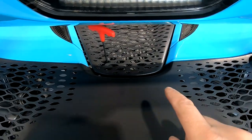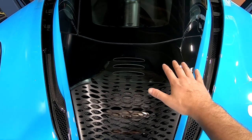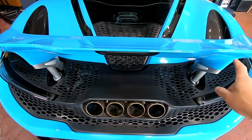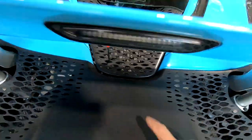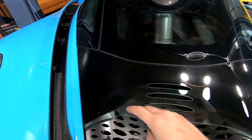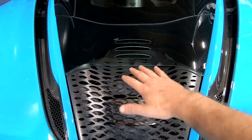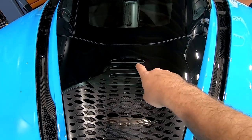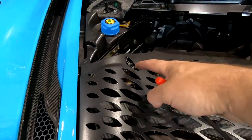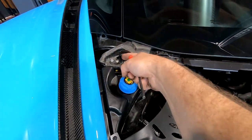One thing that is a little bit different on a 720 is you've only got a couple screws that you can clearly see, and then the whole thing sits in place. But they're a little bit different on the 765 - we've got to manually lift the air brake up, which you do not have to do on a 720. There's a screw there, screw there, screw in there, screw in there, and I believe this is just going to pop off once we get all those loose. Those screws down here are for this piece, and there's two more down there, so we're going to get those off to get this whole thing off, which will give us access to the filter and the fill points. We've flipped these two screws and these two - you can see when you turn them we've got a spring, just a little bit of turn pops right out. We've pulled this off, sits right up on here, and that is the same on a 720.